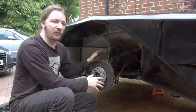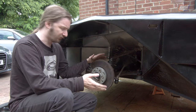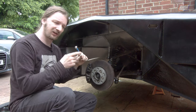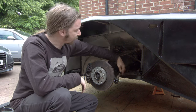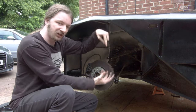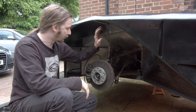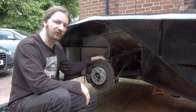Mechanically this is perfectly ready to put the wheel back on and put it back on the floor, but there are a few other things we'd like to do first. We still need to plumb our brakes, and we've got new tie rod ends because these ones are really quite badly beaten — the hex allen key heads that anchor them are so badly shot we literally can't bolt them down — so we're going to replace both of those, keeping the wheel off for good access.